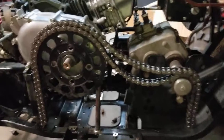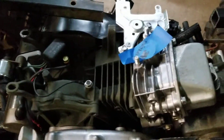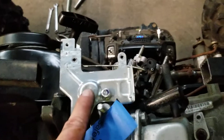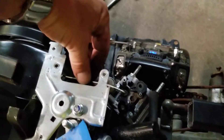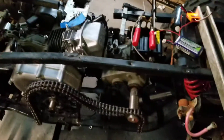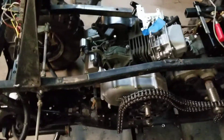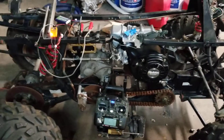We're going to have some final drive sorted out shortly. The motor is working out nicely and fits well. I'll have to make an exhaust yet. This was a governor bracket on the stock motor — it's got the little lever that runs to the governor spring — but this motor won't have a governor; it's going to be completely throttle-controlled by a servo. I'll make a little bracket to hold a servo there with direct linkage to the carburetor. It's all starting to come together — like and subscribe, and yeehaw, fun buggy!